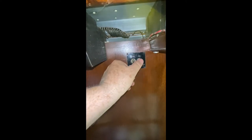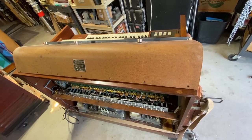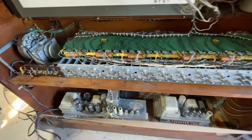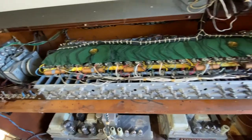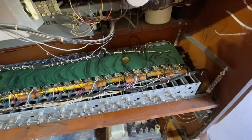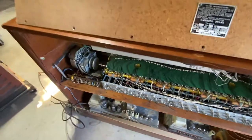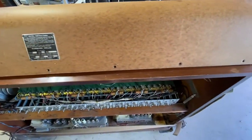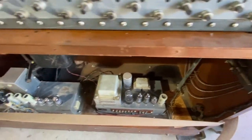Make sure the run motor switch is off. What you want to do now is take off the tone generator cover. This cover is located on the back and covers the moving parts — the tone generator, start motors, and run motors — to keep them from getting dirty. There are seven bolts on the bottom attached to the bottom frame.